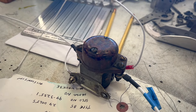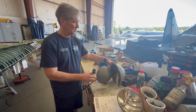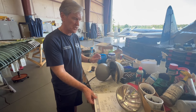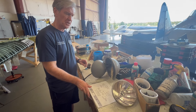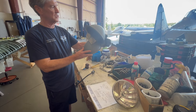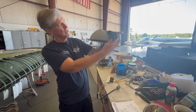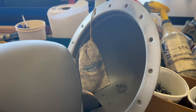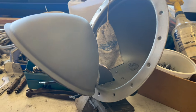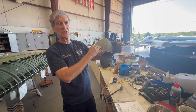The cannon plug has three wires — it's got extend, retract, and the light itself. The way this works — I thought you'd be interested in the circuit. Here you can see it's extended out, so it hangs under the wing. It's right now down to about 90 degrees. It's got a motor here that runs a gear, and that will retract it back into the wing assembly itself.